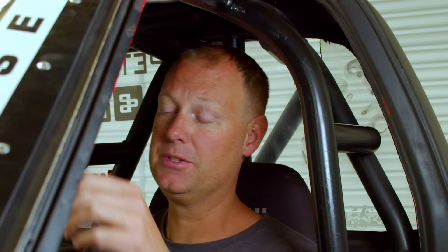We are now in a big hurry. We need to load everything up so we can leave first thing Friday morning for the Test and Tune Friday night in Arizona. I'm going to get this thing on the dyno, do a quick one or two pulls fuel-only, just to make sure the engine's fine. I get it on the dyno, start doing my pull, and it's just not right - it runs poorly. I do one more quick run, maybe I shifted wrong, maybe it was the wrong gear. Even worse result. And after that last run, I turned it off and went to start it again, and the motor cranked incredibly slow. The motor's now tight - you can't turn it over with a wrench on the dampener. It is now time for me to officially throw in the towel. I cannot make Arizona.